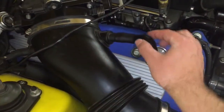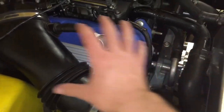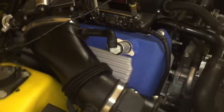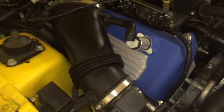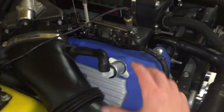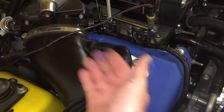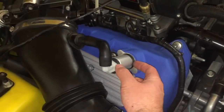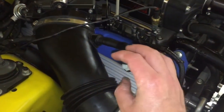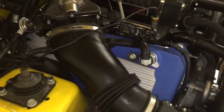Coming up the air intake, there's also this little line that vents the pressure in the cam covers — a lot of people call them valve covers, but they technically cover the cams on this overhead cam engine. You have cam covers on each side. The problem is that as it vents pressure it also sucks oil. So there are pre-filters, catch can systems, or little filters you can cap this off with — all different things you can do to address that.